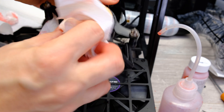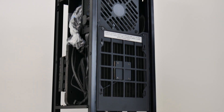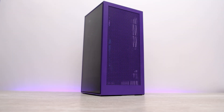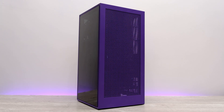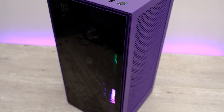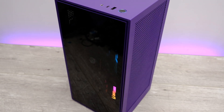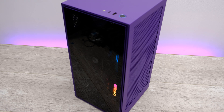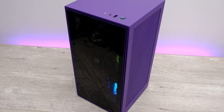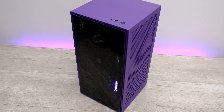Finally, go around all the components with a kitchen towel and make sure any coolant is mopped up. We can only hope this issue has been fixed with the new NZXT H1 Version 2, which includes a different all-in-one liquid cooler. Hopefully this video, while not exonerating NZXT from this issue, will help people out there with high temperatures and what appears to be pump failure — because it may just be a blocked contact plate. This is yet another issue with this case, but hopefully it's a relatively easy fix to keep your NZXT H1 going a little while longer. Thanks for watching — don't forget to like, comment, and subscribe.